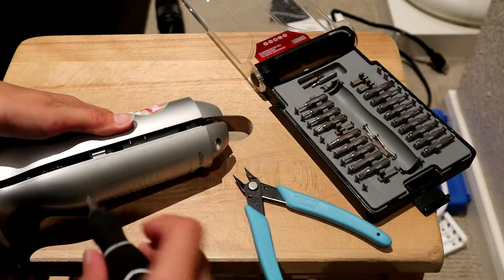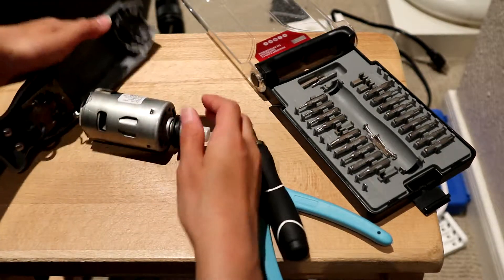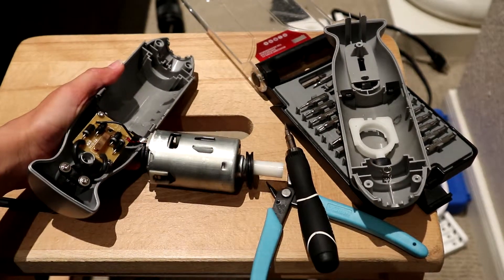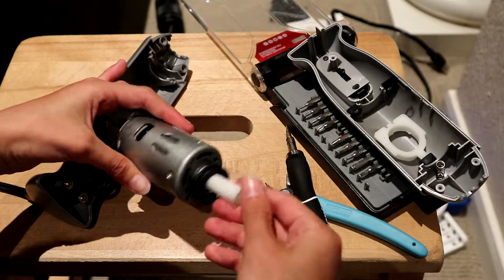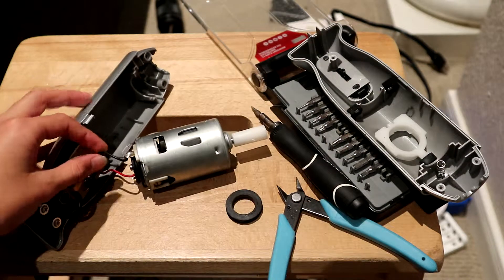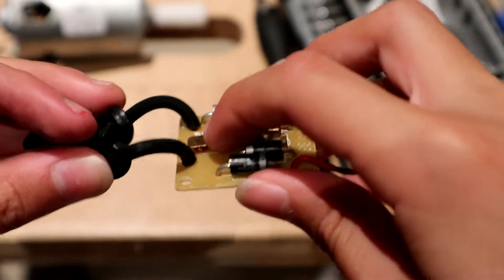I see a diode — this is unplugged. There are four big diodes, two, and some homemade switch thing, and this motor has magnets in it. This is a bridge rectifier for this motor, and these wires are super thin. This wasn't what I was expecting inside this mixer — I was just expecting an AC motor with no bridge rectifier circuit, just a switch for switching on the motor.